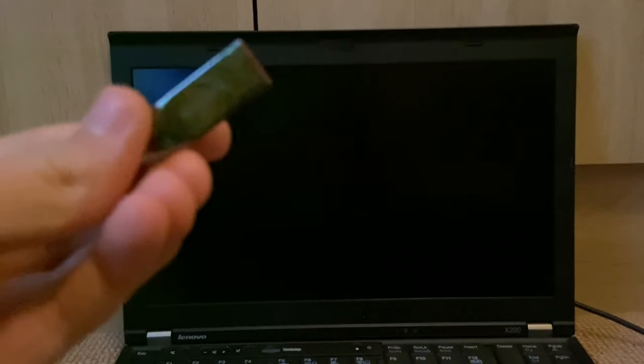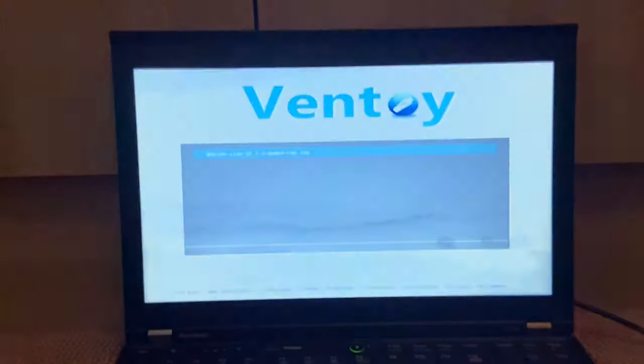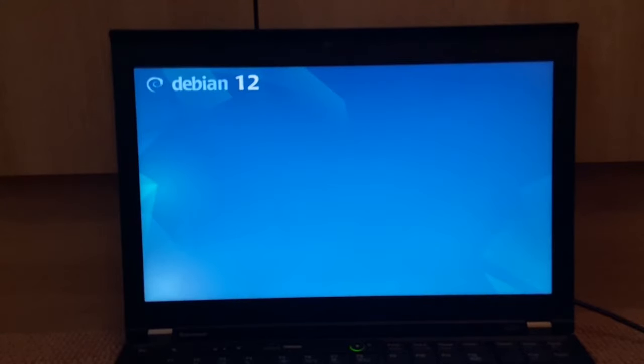So, USB stick. This contains literally everything that we need for today's episode. So I will plug this in, turn on the computer, and spam that F12 key. And I believe we can just, boom. Oh, there we go, loading. And we do not have Arch Linux on here. But whatever, let's just load up into Debian to do some partitioning things. So while that loads, I'm gonna get Arch Linux. And once I'm done with the partitioning things, I will get Arch Linux on that USB stick.